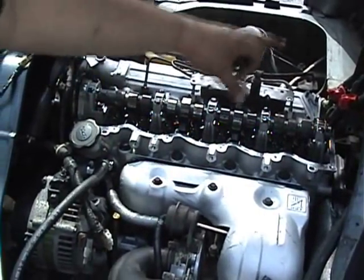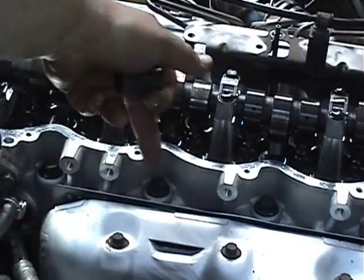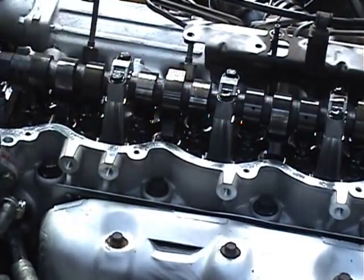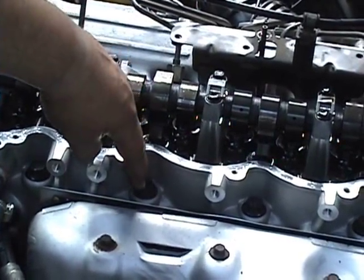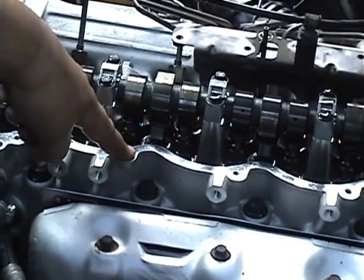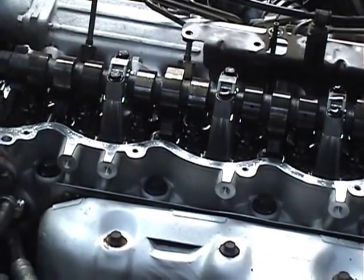And when you initially torque them all that way, then generally you could paint a dot on here and then do a 90-degree torque. And then once you've done all the bolts once and checked them, then you can do a secondary torque down from that marker that you've made on the head bolt. You torque it down another 90 to 105 degrees, and that gives you approximately the torque required to torque the head.